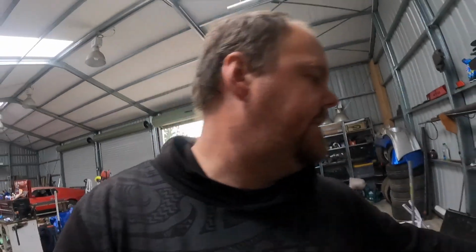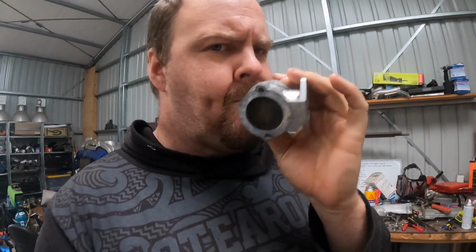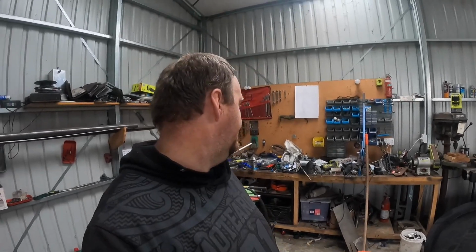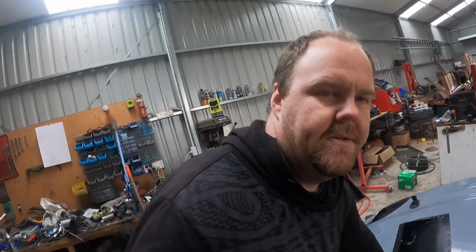And also another thing that I found was my Blitz blow-off valve. When you blow through there, it comes straight out the bottom there, so without having vacuum pressure or boost pressure on top of that at 20 pound of boost, it's very likely that that was opening up and just working like a wastegate on the intake side. So I've replaced that now, which sucks because I really like the noise that made. But what I did is I took the trumpet off that and made an adapter so it fits on my old Turbo Smart one.